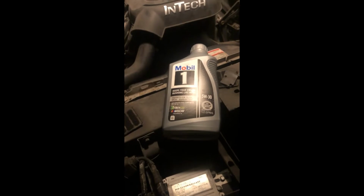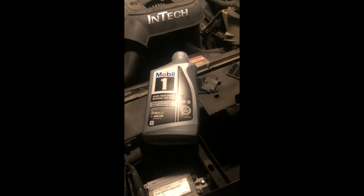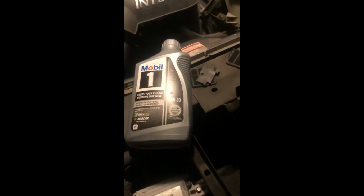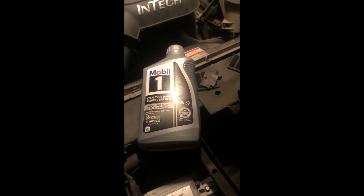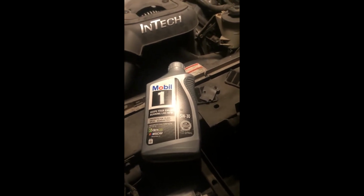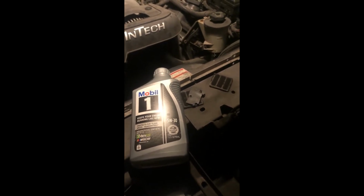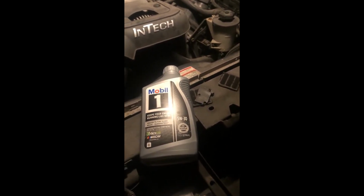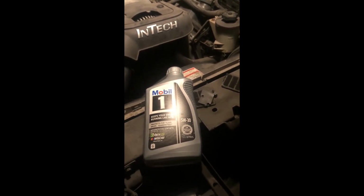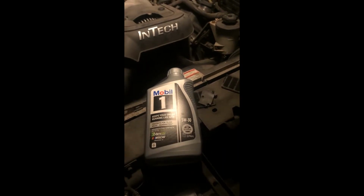Now, I have an '04 Mercury Grand Marquis with the 4.6. It's a 2-valve versus a 4-valve. It calls for 5W20. It says it right on the oil cap. It also gets Mobil 1. Now, I'm not sponsored by Mobil 1. I don't have enough subscribers for a sponsorship. I pay for all this, and from my research and from my results from when I took the valve covers off to do the timing set on that Mercury, everything was extremely clean. I'll try to put some pictures in there from what I saw, but extremely clean after I'd done the first couple oil changes with Mobil 1, and everything looked basically brand new. So that's what's going back in it. That's what I'm going to run.